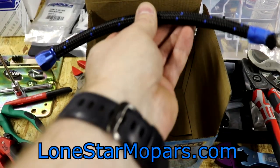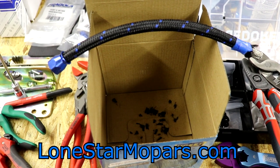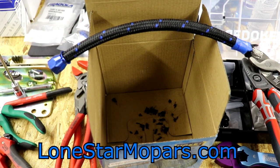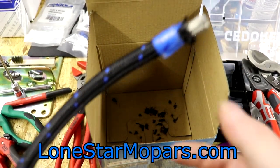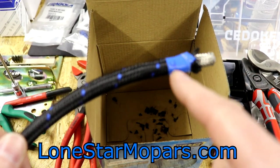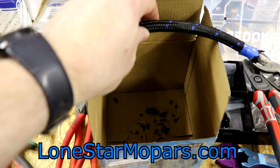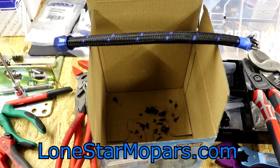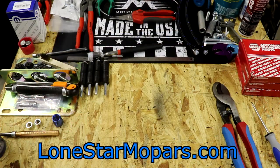The weapon of choice for cutting is Channel Lock cable shears. They work really well but I hate using them for stainless because it will prematurely wear the blades. Even with the Code Blue handles — which are an upgrade — these are sub-$30. Other options: a whiz wheel would work good. A chop saw seems like overkill but actually does cut decent. Keep in mind you're going through Teflon, stainless, and nylon braid — factor in how you'll clean that up. The bigger the shears, the more leverage, the easier to make a clean cut in one stroke.